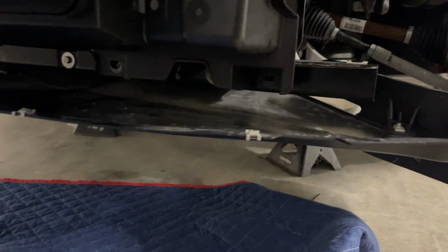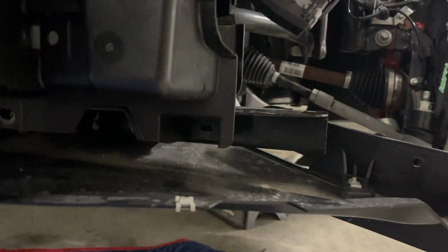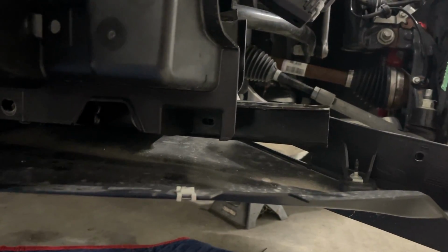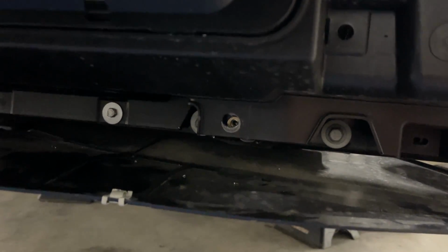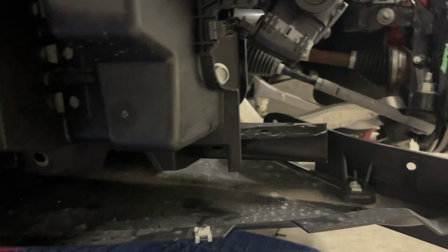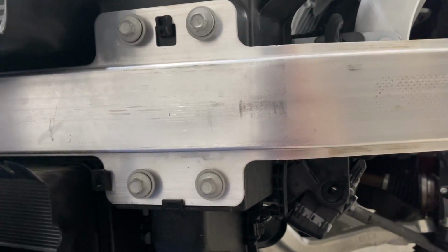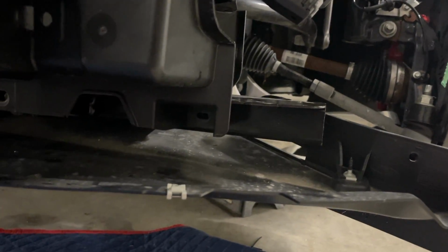All right, well, I just realized something. I didn't even see these two at the very end corners. I can drill them and put nut certs in there, and I would still have four bolts. And those right there that I put in don't really matter at all if they're not long enough. It's not difficult. I basically got everything in here kind of loose. I'm just going to take those back out and put nut certs in there too.